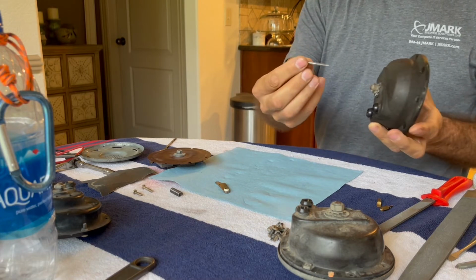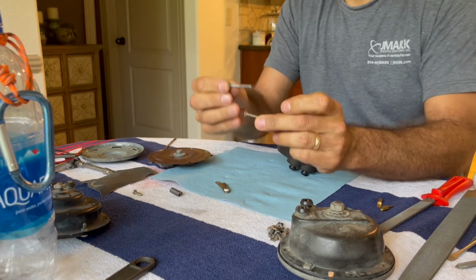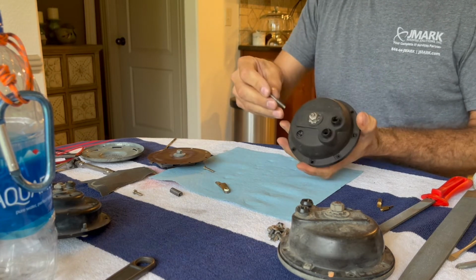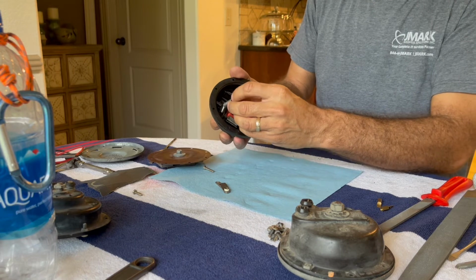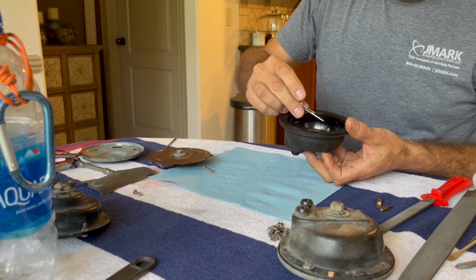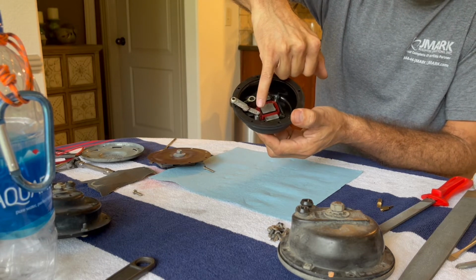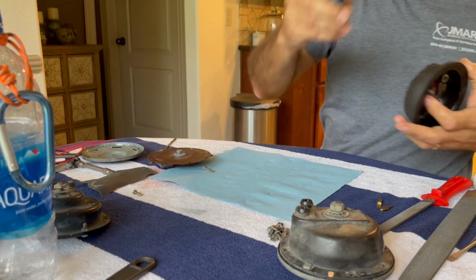And basically we take our long bolt. Quick rant, that's a bolt, that's a screw. Unthreaded shaft, bolt. Threads all the way to the head, screw. Okay, quick rant over. So we put our adjusting screw in that hole there, come around to this side, put our spring in place, and we thread up into the long arm of our points system here. Go ahead and grab my Phillips head.